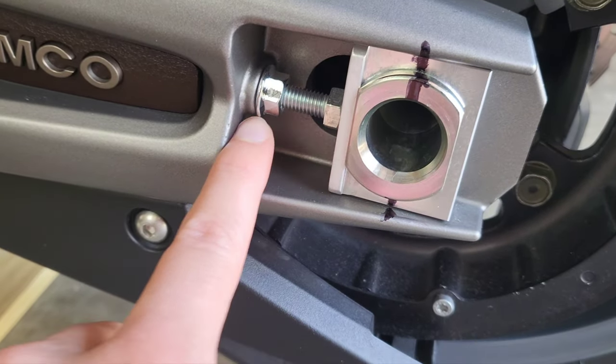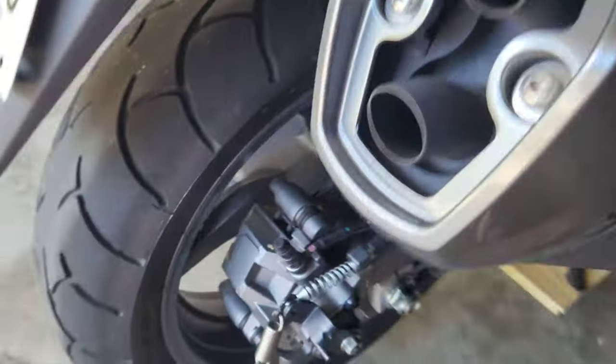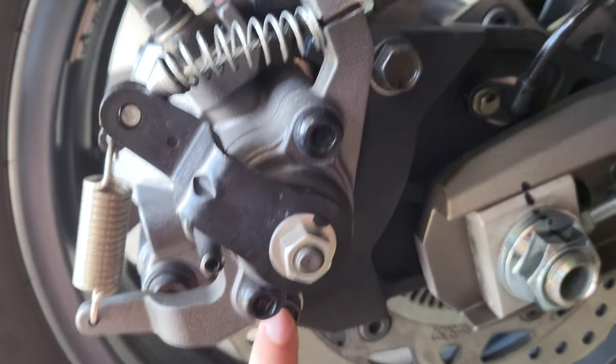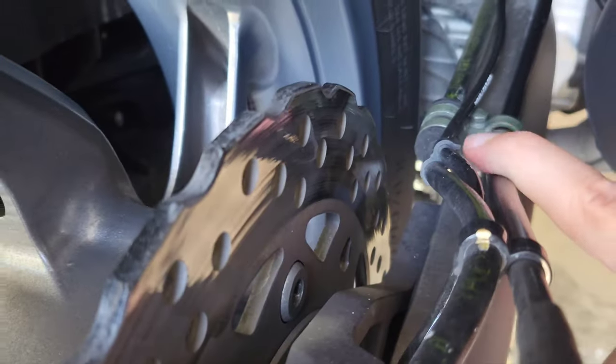This is your lock — move that back with the 12mm. Before you do that, you want to take off your brake caliper with these two bolts, your speed sensor, and take off the cables from this bracket right here.